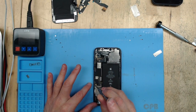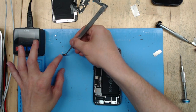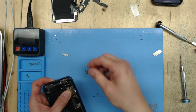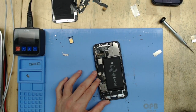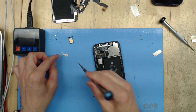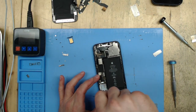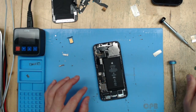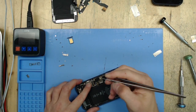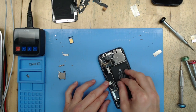We're back to the tri-wing. We're just going to take this shield off and get all these screws out that hold the SIM tray in. Okay, we've got the SIM card out now — used the tweezer to eject it. It's the handiest ejector, even though there's one hanging right next to this on my microscope. I just like to do what's most efficient and fastest. It's a very busy shop; we've got to keep these repairs going. We've got the SIM reader out.